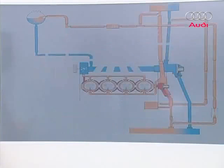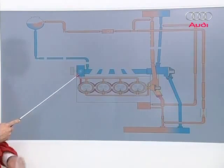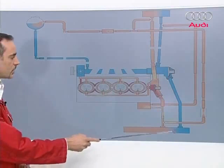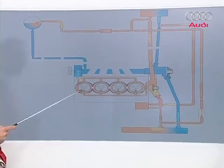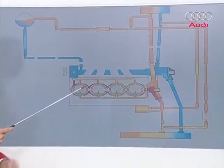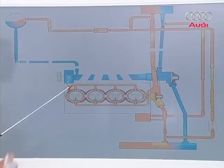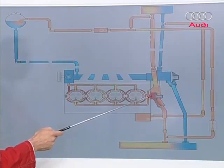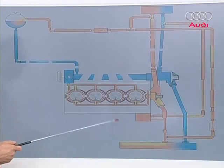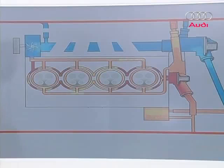The second animation deals with the main flow cycle, where we can recognize the engine block better. Here we have the primary coolant pump acting as an actuator. The coolant is directed through a bypass line near the engine block, flowing into the block itself where it takes two separate paths: on one hand, it is directed around the cylinders in the high-temperature area; the remaining coolant is sent upwards to cool the cylinder head, a somewhat cooler area. It then exits right here where the thermostat is. We can see exactly how the coolant flows separately to the block and to the head.